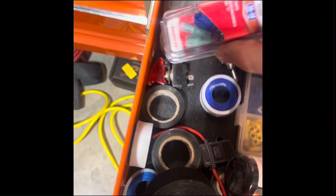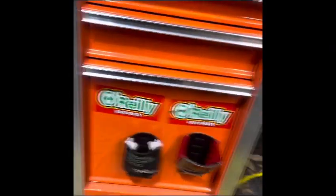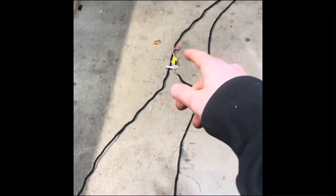More than likely, I'll just use, let me find them, some of these. I know people don't really like these T-taps, but it's not like cruise is a very important feature, or, you know, I wouldn't run that to anything important. If one of those connectors stops cruise from working, I'll just figure out what went wrong. It isn't enough trouble for me to want to solder this in place. So all these, this VSS and the cruise indicator, I'll be able to just screw into the Dakota box. The 2 brake switch wires, I'll probably just T-tap. And then those, I'll actually solder in. This portion, I can still unplug it from wherever I have it plugged in, and this whole harness will be removable.